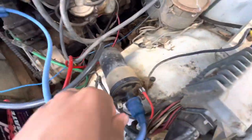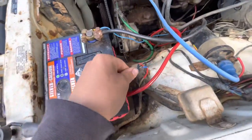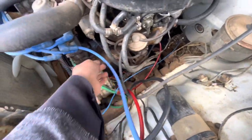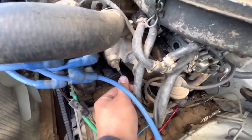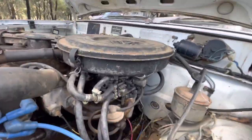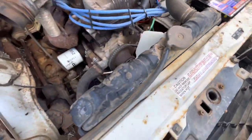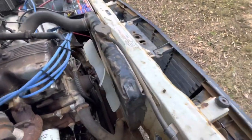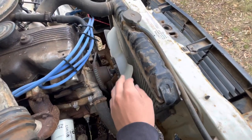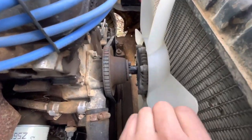It's not a very big engine but it goes all right. It's got some weird Mopar ignition system in there but it works. I redid some of the wiring — cleaned up these connectors and painted the positive wire red with some heat paint, redid this positive wire. Those are the earth wires with the trailer plug. Cleaned up all the earth wires and the sender unit wires for the temperature gauge, cleaned up the starter wires. It's got a different carburetor on it — actually out of a van. This is a petrol radiator and the clutch fan is out of a Toyota, but it's exactly the same. It's a seven-blade; the old one was a six-blade.